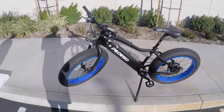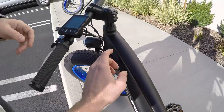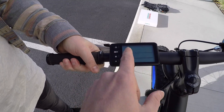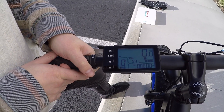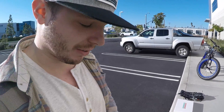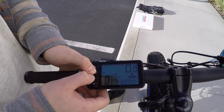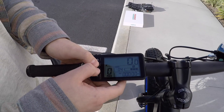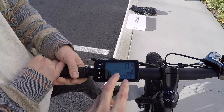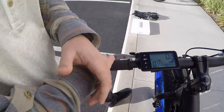Maybe you could walk me through the display a little bit, Paul? Sure. First, press the power button on top of the battery pack, then come up here and press the power button again on the front display — it'll cycle on. One of the features the down tube battery offers beyond a rear rack battery: you can actually get your charge percentage, your cycles, and the voltage of your BMS. We're at 54% right now. Hit set and plus — it's the fourth cycle of the battery. Batteries get between 500 and 1,000 cycles. Hit it one more time and you can see the actual voltage of the battery, which is helpful for knowing the overall battery life and for servicing.